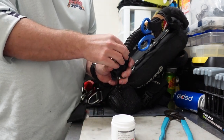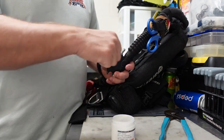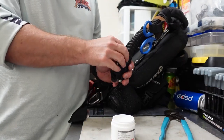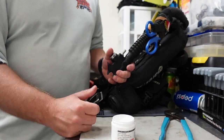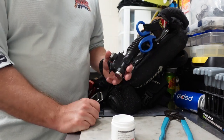I'm going to screw this back in and get it seated. When you seat it, you want to make sure that you use the proper size wrench. Just give it a little tender loving care — don't really tighten it down too much. Basically, hand tight is all you need, because you will strip out the threads or crack the housing if you're not careful.